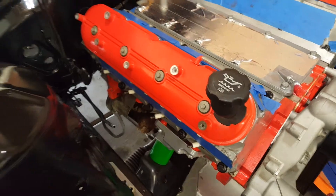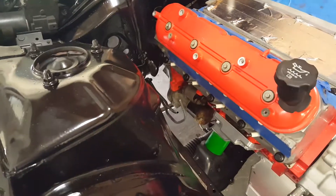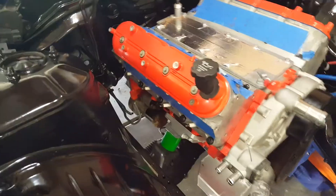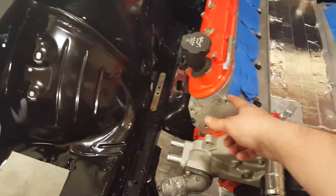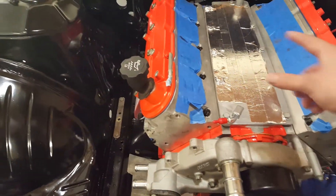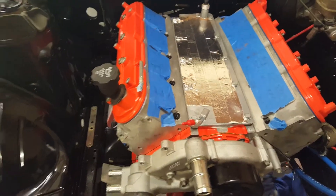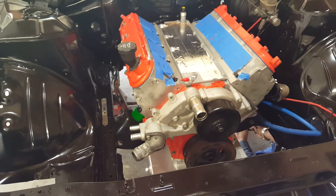We basically used my lucky strap, moved it a little bit — it didn't end up going in, but it kind of gave us a better idea on the angle and moving in the right direction. So then we ended up just running a chain from these two head bolts, and it was kind of an arch. We had a jack underneath the back of the transmission so it could just roll back as we pushed in on the hoist on the engine.